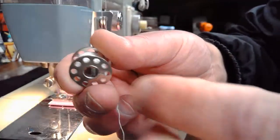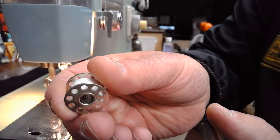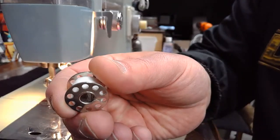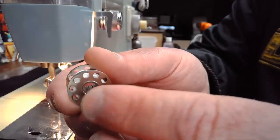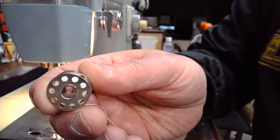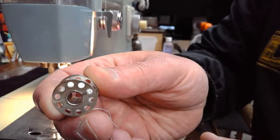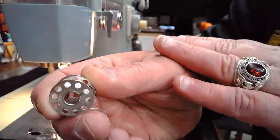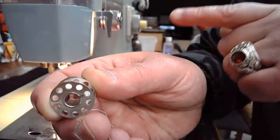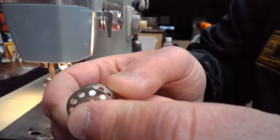Remember we had that quandary with Kathy's hand crank 170th anniversary machine. I highlighted the machine was made in India and they totally messed up the manual. They were telling you to insert the bobbin in a way that was totally incorrect. They were telling you the flat side of the needle on that machine should go to the left. In fact, on Kathy's, it should go to the right. And I didn't mention that on this machine as well. This Japanese Fleetwood machine from 1957, the flat side on this needle goes to the right as well, just like Kathy's 170th anniversary hand crank.